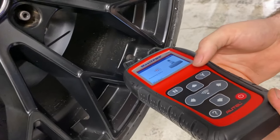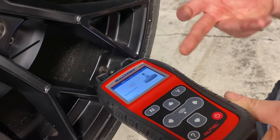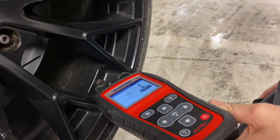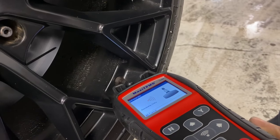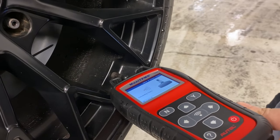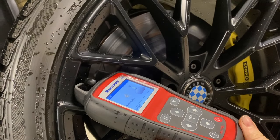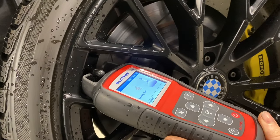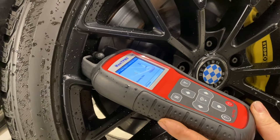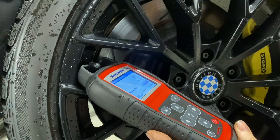Trigger it again — nothing coming out of that one. If it doesn't get a signal it's going to say it failed. That usually means the battery died on it, or when someone changed the tire they snapped the TPMS inside, or the battery died. There's no way to replace the battery — you just have to replace the whole sensor. So the tool is reading the frequency that is supposed to be for this model. The car has an antenna somewhere, and this is doing the same job that the antenna is doing.